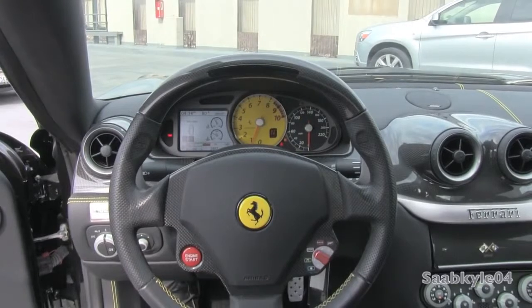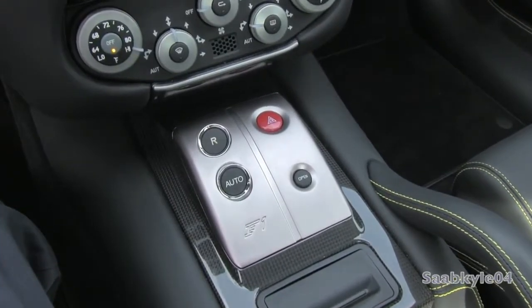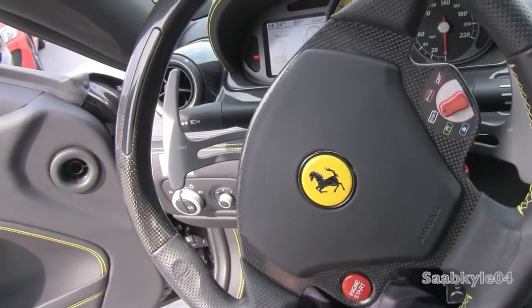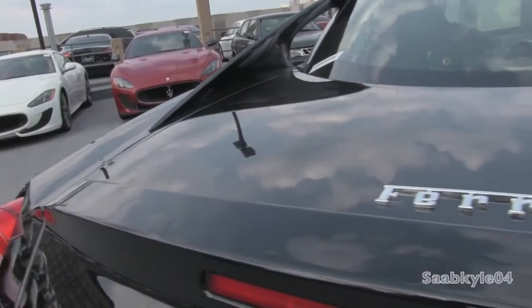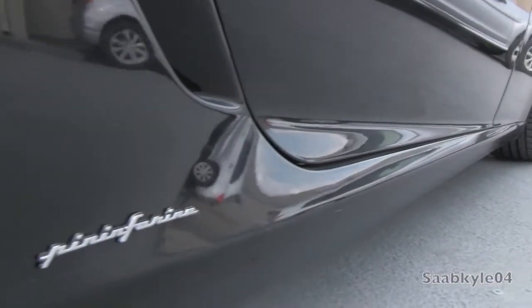There were two transmissions available, first being a 6-speed manual gearbox or an all-new automated manual paired with a revised F1 traction control system and electronic limited slip differential. The latter gearbox, dubbed F1 Superfast, is a revised version of Ferrari's 6-speed automated manual that works to preload or prep the next gear before the clutch is fully disengaged, combining the action of both clutch work and gear selection.